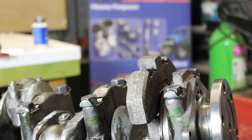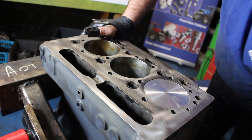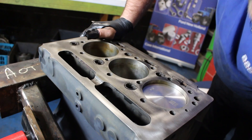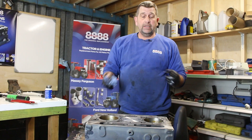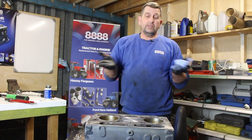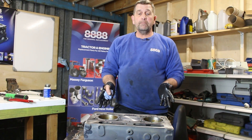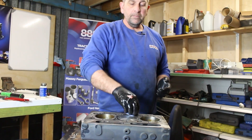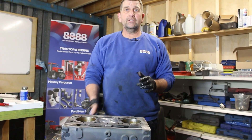They're just nipped up — turn it over again, everything's fine, they're all moving really well, nice and easy. Once all the oil starts getting around they're going to move a lot better. That is fitting our pistons into the block and connecting them to the crankshaft — as easy as that. But take your time; if things don't go quite right, stop. That's as far as we're going today. I hope you enjoyed this episode — I'm going to get filming a few more so we can get more videos out there for you to enjoy. See you next time.